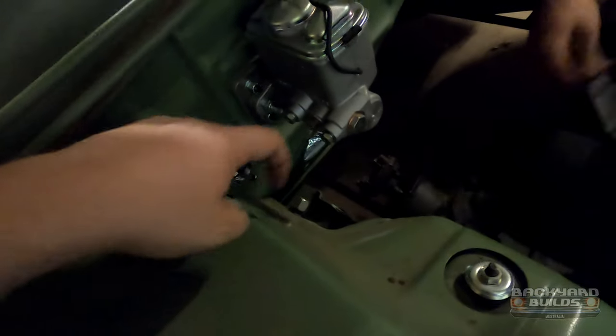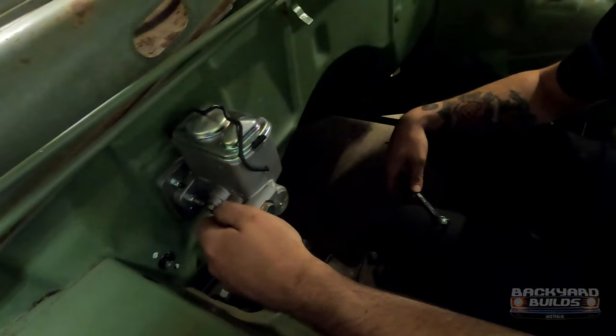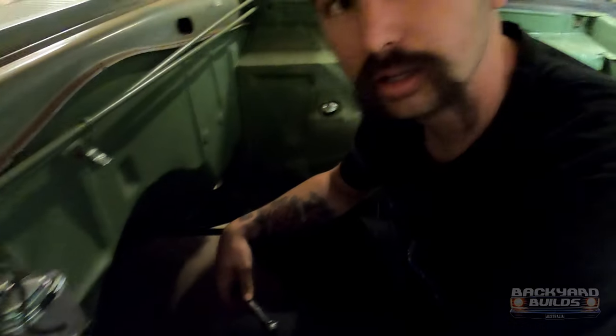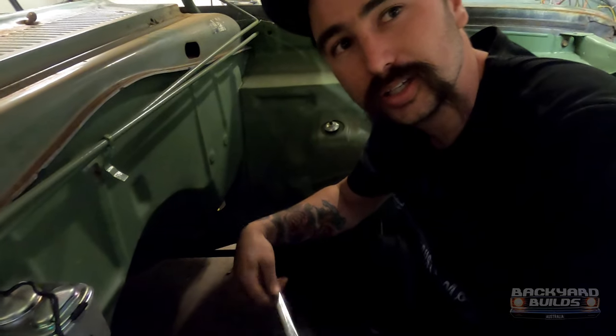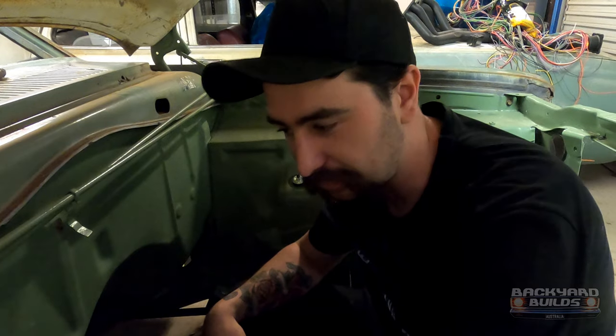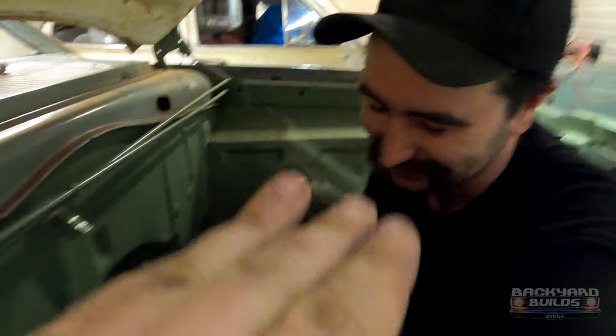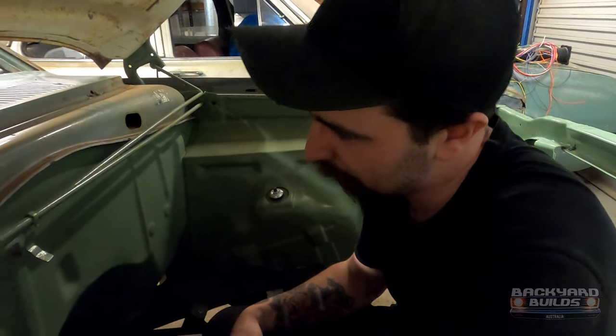We still need to drill one more hole. Which one of these isn't a brake line? The center one's not the line - it's got a blank and a ball bearing in it, so don't take that out. What's the center one for? Brake light switch - which is where it's going to go because I didn't put it back on the pedal. Actually it would be the emergency brake light switch - a fail switch for the dash. Yeah, a little switch - so if you lose brake pedal pressure it would show a light on the dash, I would assume. Mate, it's 1966 - there's no brake warning light on the dash. It's charge and oil pressure, that is it. Too used to working on Holdens where they were more advanced - more safety in mind.